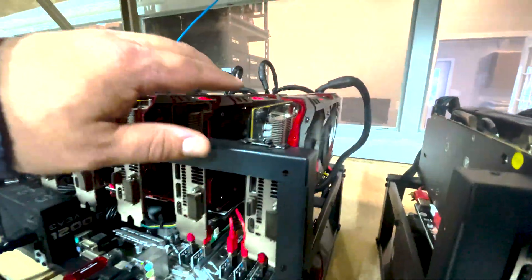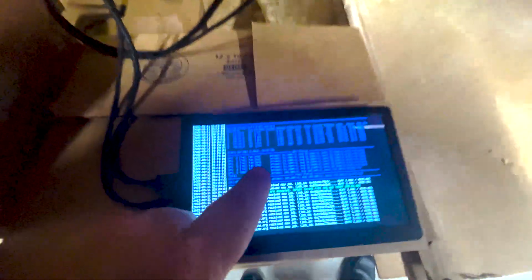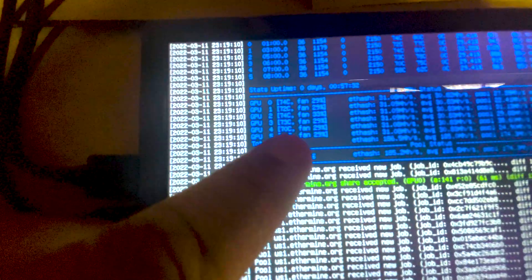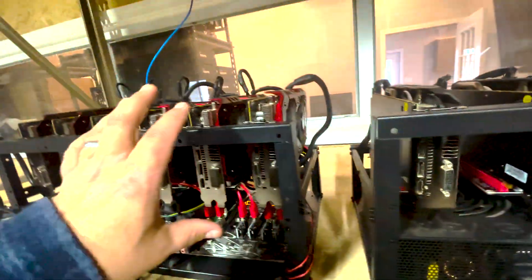On some of this testing — you can see these RX 580s, the Red Devils — those things are running. We only have the fans running at 30%. I like to see if we can maintain under 75°C at 30% fan speed. That's a critical number. People always ask me what fan speed they should run — I like to make sure you can be at 75°C or lower at 30% fan speed.